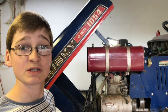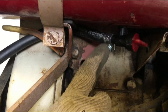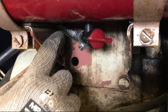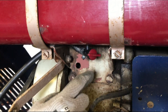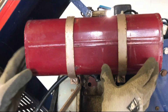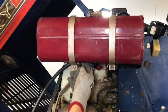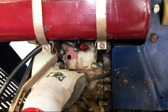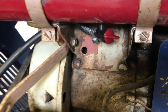We've decided we're putting a new fuel hose on. We've already got it on the tap and it's being held on there by a jubilee clip. It loops behind this bracket, which we thought would be too difficult to loop through and then put on the tap, so what we ended up doing was taking the fuel tank off, putting it on here, and then looping the other end through that hole.